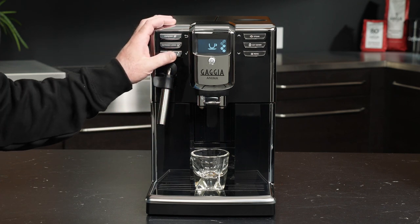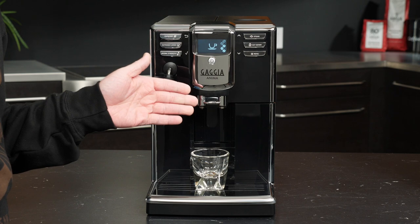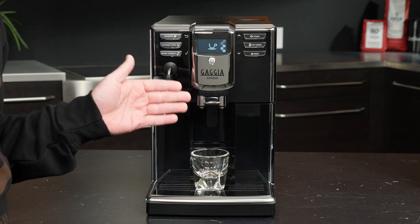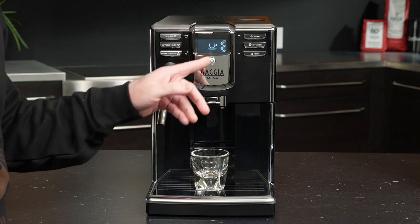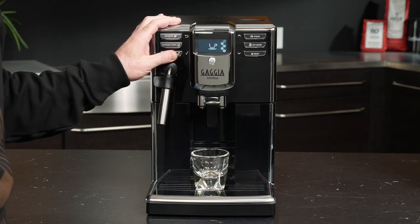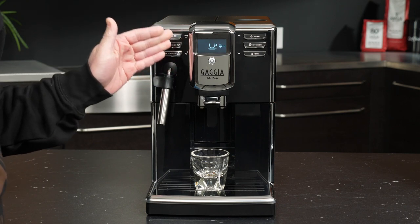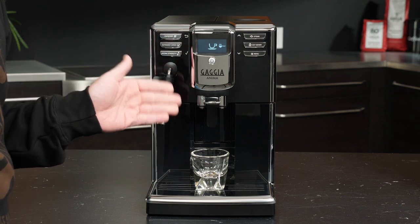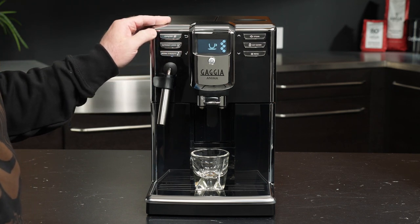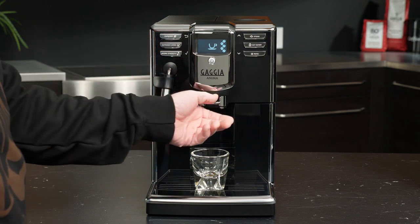Aroma strength — this button on the bottom left — corresponds to the maximum amount of ground coffee being used in your shots. The range is between six and a half and eleven and a half grams, and by pressing this button you can see the beans on the display illuminate letting us know our current selection. If you ever go beyond five, that will show you the scoop icon, and that's how we would go ahead and load coffee in using the bypass doser. I'm a highly caffeinated kind of guy so I'm going to set this to five-bean strength and take a look at how you brew an espresso using the Gaggia Anima.